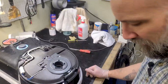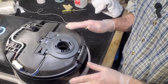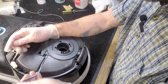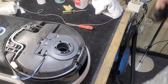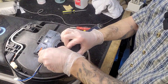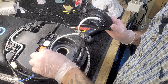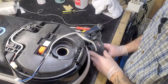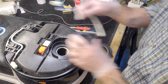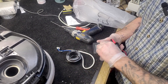The design of this machine is really cool. The machine is four or five years old and it's pretty rare that we do this repair. You have a Molex connector over here — we'll unclick that and pull those wires out. There are four screws to pop out, and if I remember correctly they're all the same size. This is going to pop right up for us. Your bag sensor is right there, so if you were doing a bag sensor or full sensor repair, this is what you'd be accessing as well. There are two washers here — we'll get those out of the way. Now we've got that wire harness out.